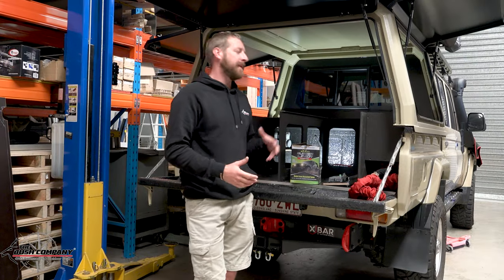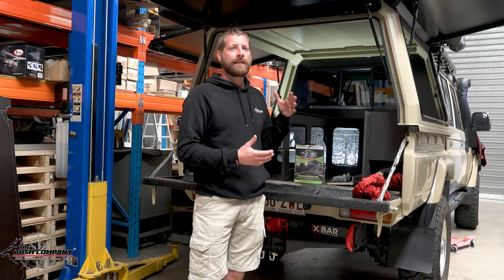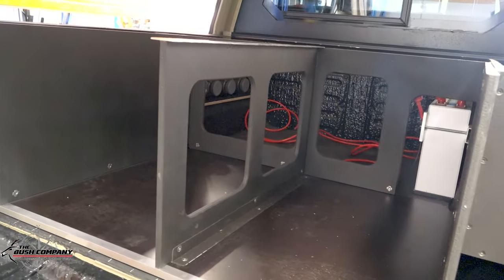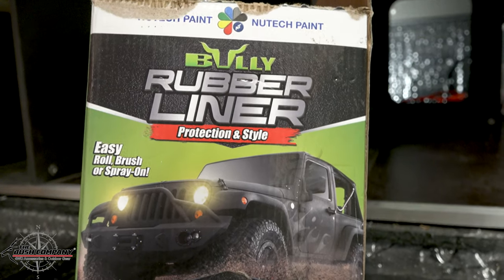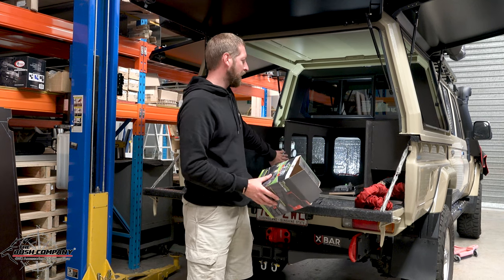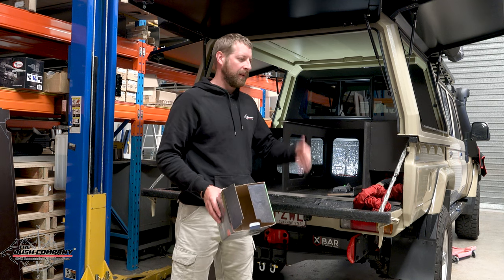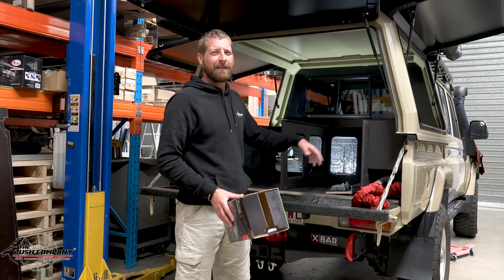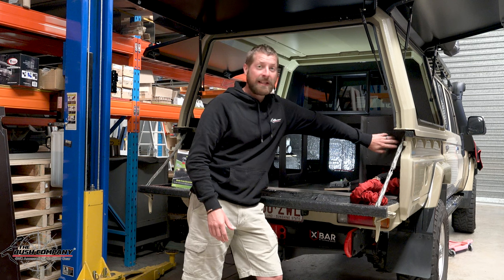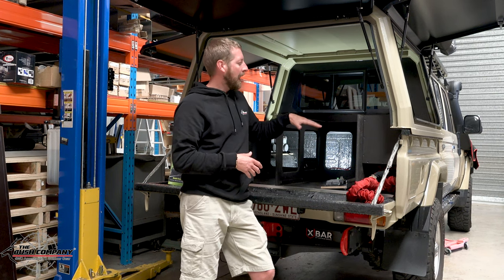This is an update - it's now at least three days into the job. Marking up and cutting timber takes time. The carcass is in and we've actually sprayed and sealed it. I went to Bunnings and bought their Bully rubber liner - it has a rubber compound in it, makes it look nice and black, and gives it a waterproof layer. The lighter plywood needed a waterproof layer since kids' towels and wet swimming costumes will go in there. The gun box or fishing rod storage box on this side is now complete, framed up, mounted directly above the wheel arch, and bolted through the side of the main frame.